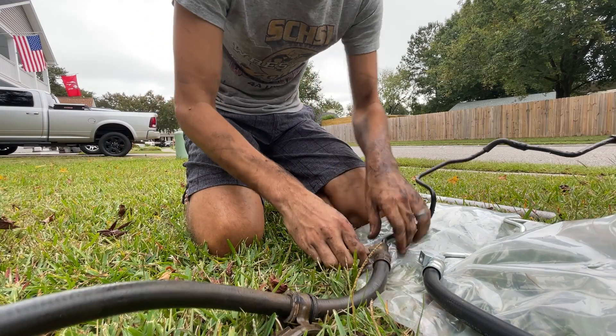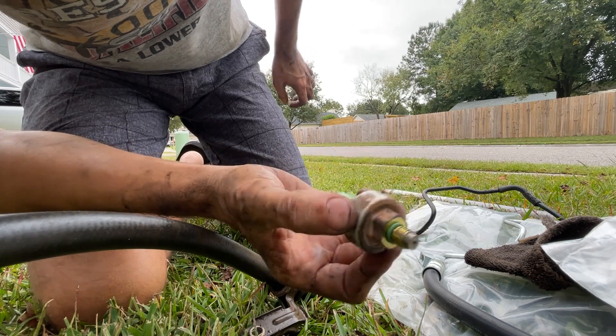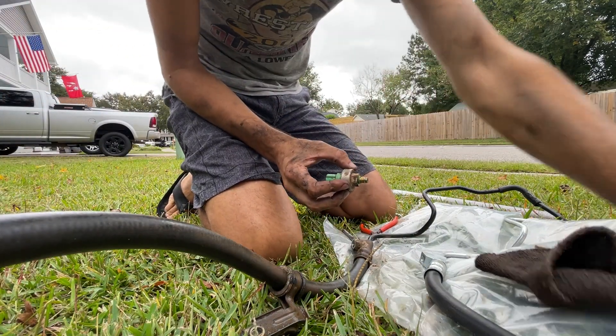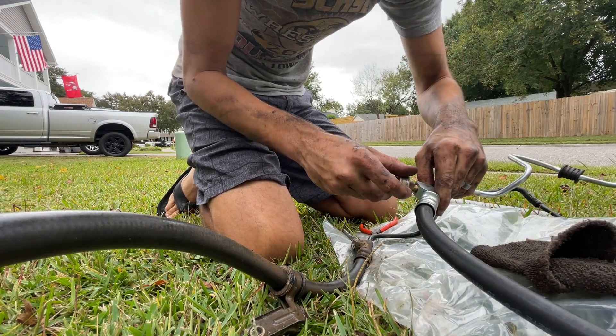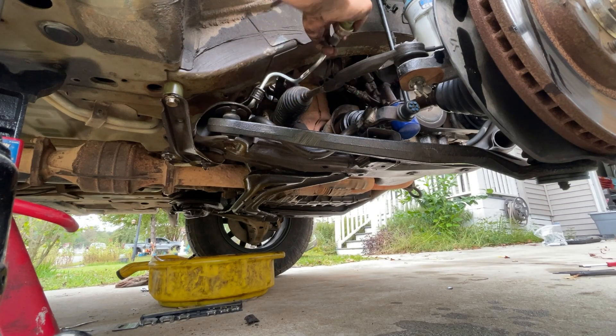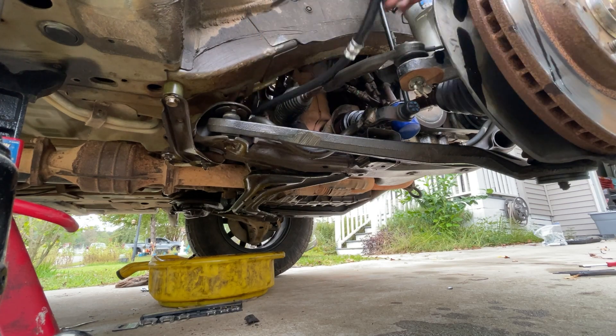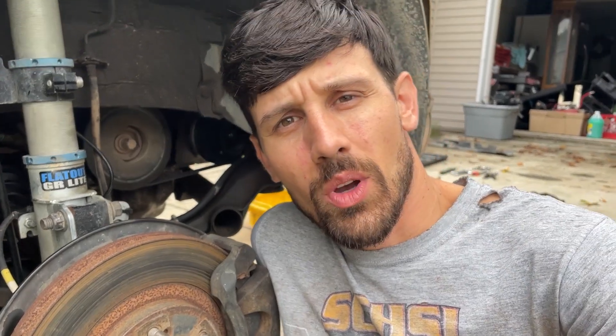Yes, we did. We got the new green o-ring on there, got it cleaned up, and we're going to screw this in. I was able to get the bottom portion of the power steering line — the hard line — back into the rack and pinion. I was worried about cross-threading it but it turned out that didn't happen. I was careful with the threads and I got it all buttoned up.